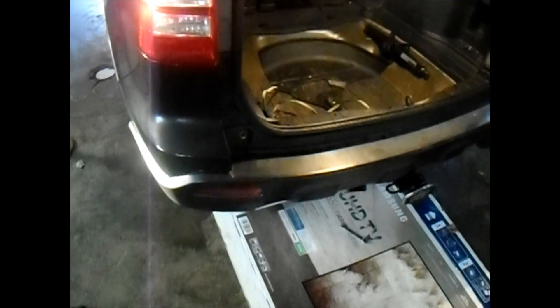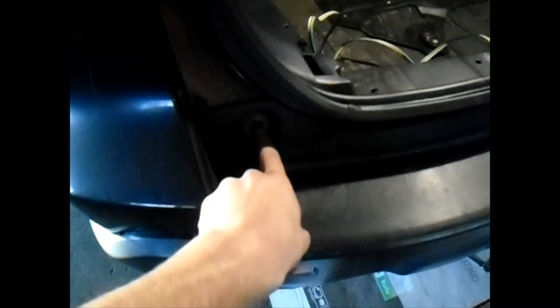I'm going to apologize now for my lighting — I have a work light here and lights on the bench. To remove your rear bumper, what you're going to need to do is use your T30 socket to pull off this bolt and this bolt. There's a little cover here and a little cover here — you pry off with your screwdriver, and there's a 10mm bolt behind it. You want to take those off on both corners.